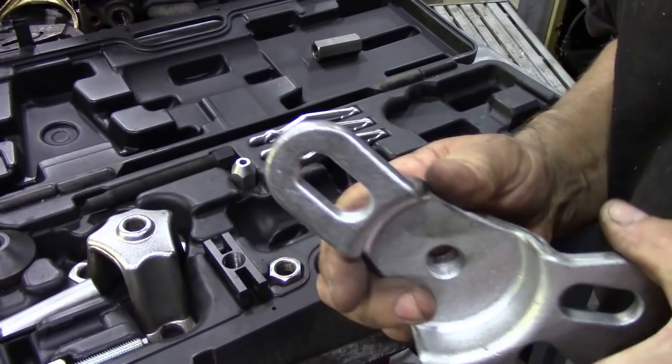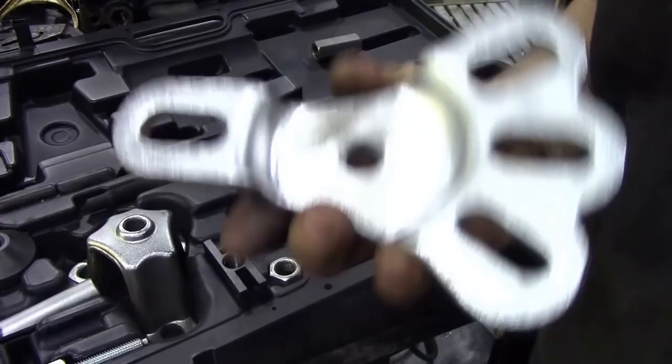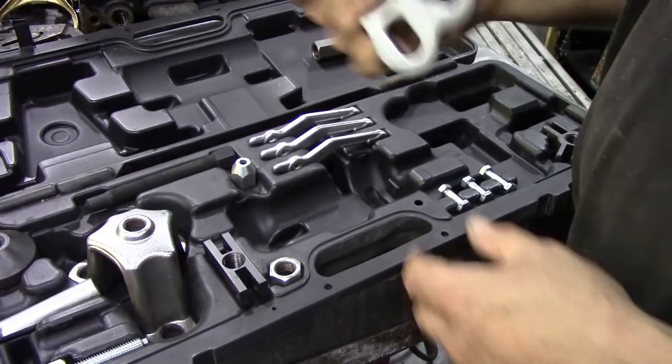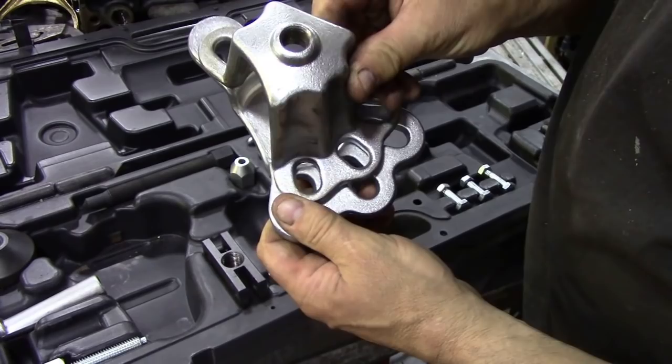This was a really handy thing — it was for pulling the flanges off the Subaru. It got some stick because we couldn't get them off; we were banging away trying to get those bearings out. We got it off eventually, but without this tool there was no way. There's a shallow one here and a deeper one — if there's a hub nut or something in your flange you can use the deeper one. The pattern is a little bit smaller too.